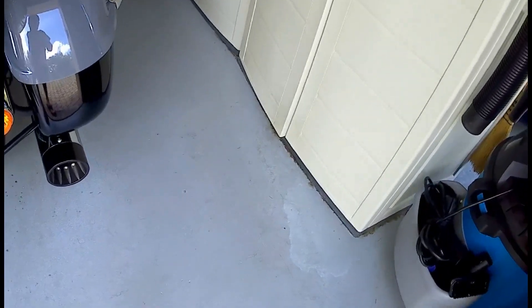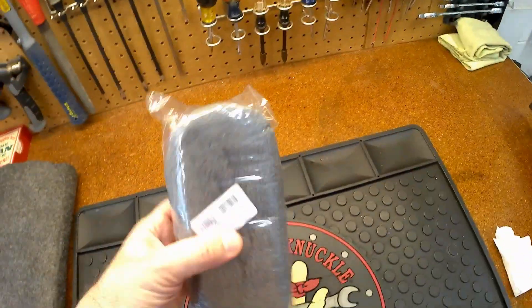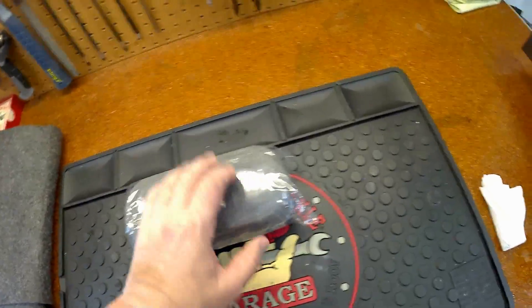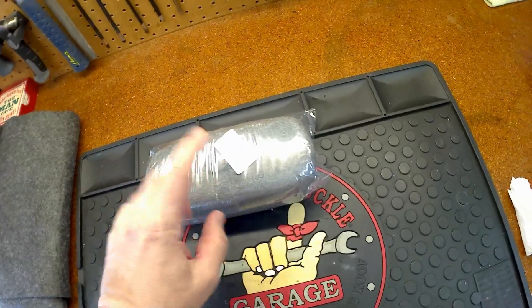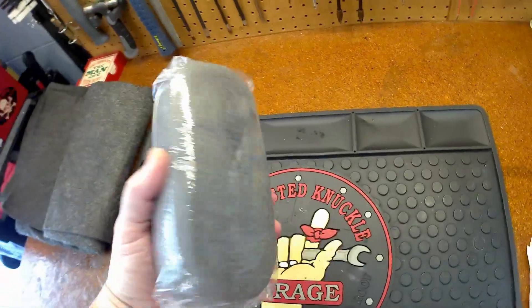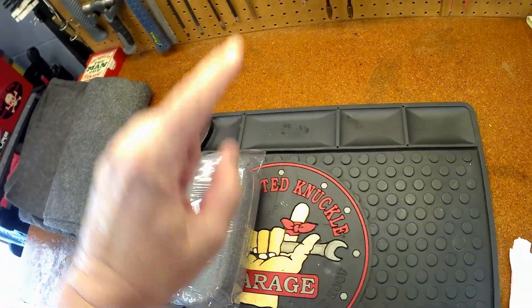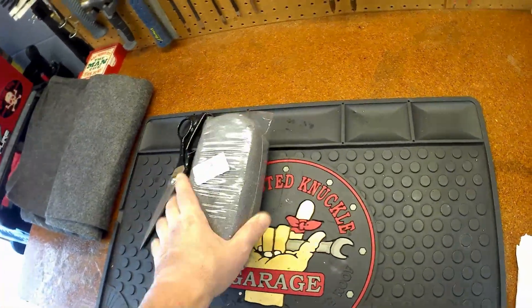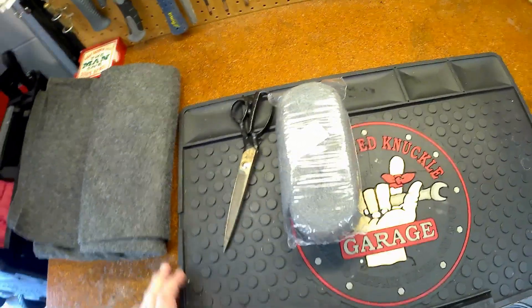I thought, you know what, I went ahead and took it apart, put some of the baffles back, and I thought I had a neat idea to go ahead and fix this thing permanently. So today we're going to use this. Now this isn't regular steel wool - this is stainless steel. The last thing you want to do is put regular steel wool in there and have it start rusting and make a mess out of your pipes. So this is stainless steel wool, and I'll use some good old scissors and cut this, and basically make like a stainless steel gasket to push in there.